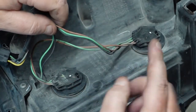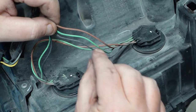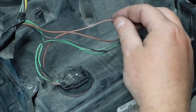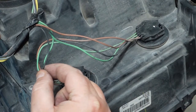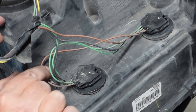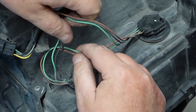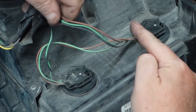The three wires that run up to this top light are a brown, the brown tannish color, the green, and a black. We're going to go into the black and we're going to go into the tan one, because this other tan wire right here runs from this top light to the bottom light. When we tap into our ground down here on our bottom light, that's when we're going to use this other brown wire. We've got our three wires up here — we're going to tap into this brown one that goes up from the wire, not the one that comes down from here to here, but the one that comes from the pigtail itself up to the top light.